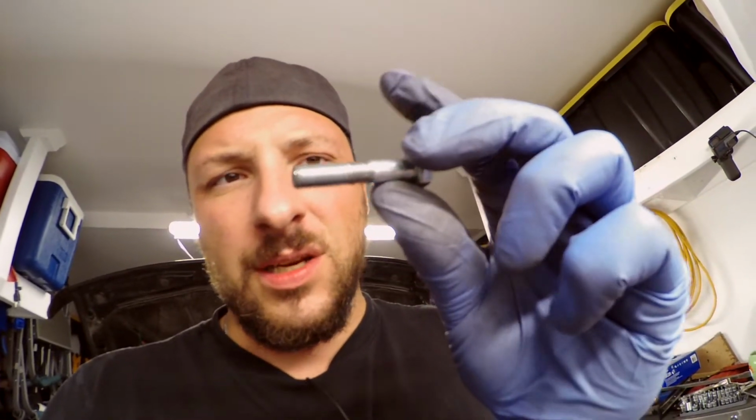Well, all right, guys. I'd say that's a success. Got that guy going there. I ground it down so it's the right length now. Tapped it a little bit further on the edge there, a little bit further down because the neck wasn't the same size as the other one. So now it's pretty much the same as this guy.